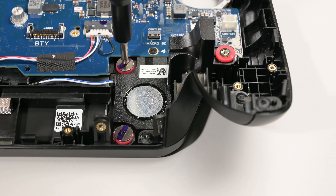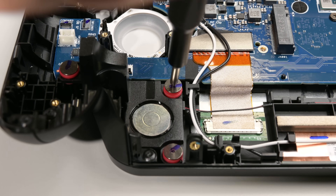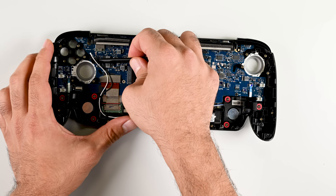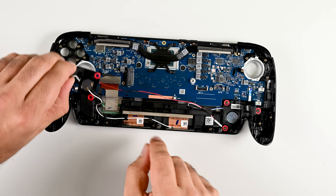The speakers are last on my list of modules. I have three screws per speaker, each mounted on a vibration soaking grommet. With these removed I can disconnect the connector on the mainboard, and to remove them fully I also need to pop the coax cable running to the wireless card — which unfortunately is soldered to the mainboard, so pray it doesn't fail.